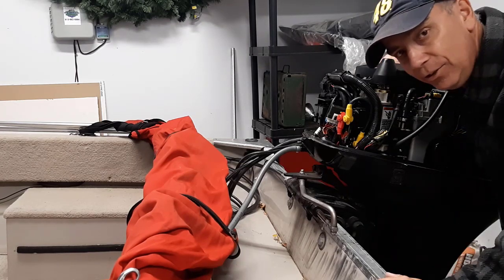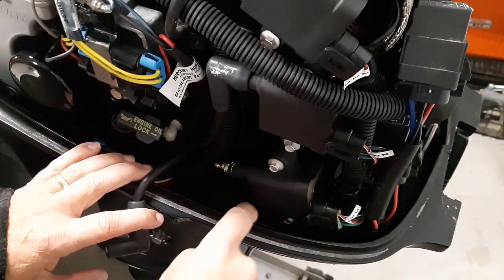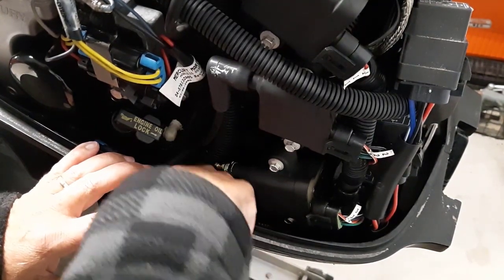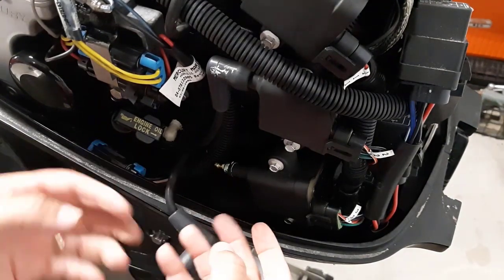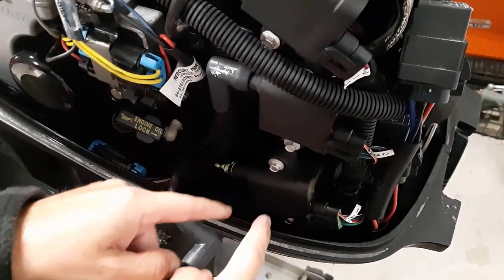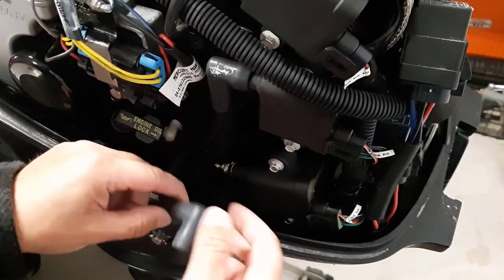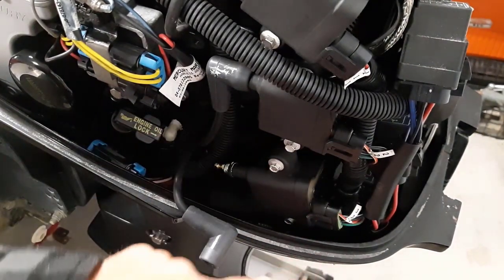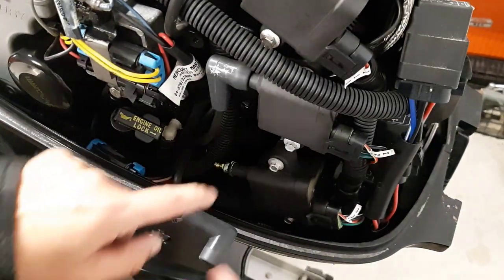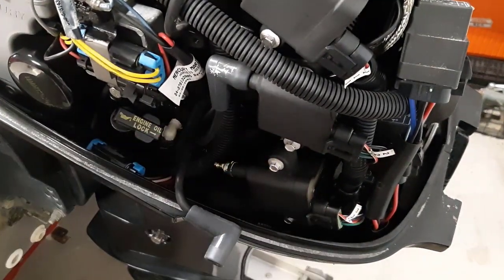You likely won't be able to see it, but under this part here — I'm not even sure what this part is — your fuel lines are right here inside a black sleeve, and that's where your fuel filter is, way down in there. The only way I can see to get at it is to take this part off. It's just bolted on here. I took this electrical connection off and let it lay to the side — that gives me access to the filter. There's a bolt here and a bolt here that mount it to the motor.